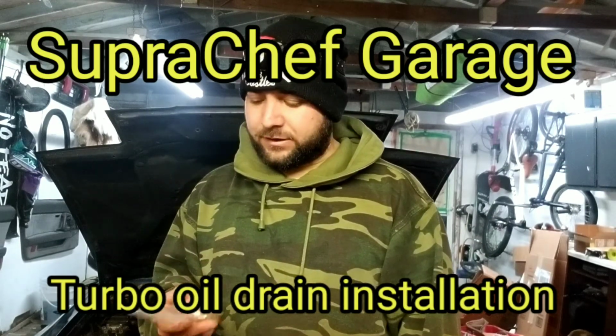Tonight's video, I'll be doing a little change of my oil drain here. So when I bought my CXRACING Turbo a few years ago, it came with this style of oil drain. It's a barb fitting to go on a rubber hose, or you might be able to get it on a braided hose as well. But I have AN fittings on mine, so I ordered one of these because I retrofitted the old one to work by drilling the holes more centered, and it worked. But this one here is meant for the AN.